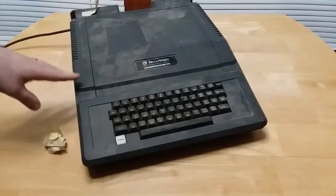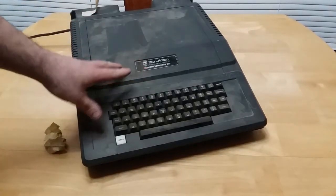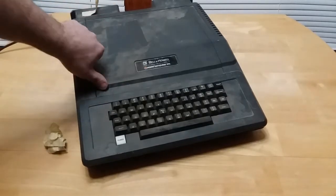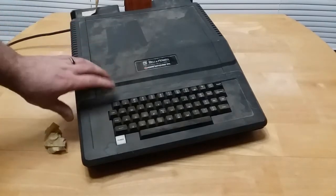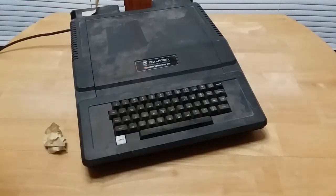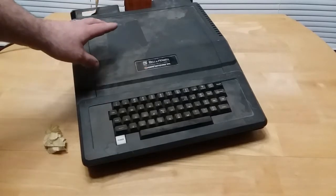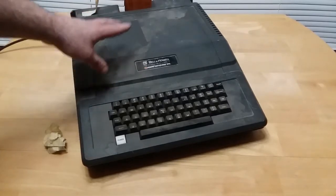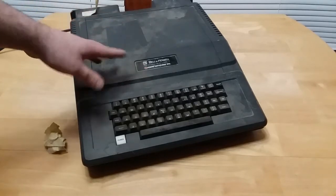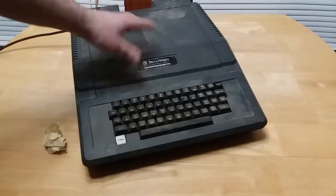of the UL listing, which is why this machine even exists. So the reason why Bell & Howell even has a branded, basically color variant Apple II Plus is because certain schools could only buy appliances and equipment for learning if it met UL listings. And to paraphrase and, in layman's terms, sum this up, if you can open an electronic device while it's under power and easily access the internal circuitry, it doesn't meet listings, because somebody could just take this cover off, put their hand on the motherboard while it's under power, and either damage the circuit board or cause harm or death to whoever just touched the motherboard.